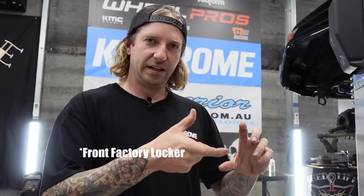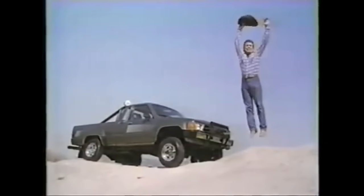Unfortunately we're sticking with the factory locker. As we all know, there is a slight design fault in the front diffs - the adjusting nut on the Toyotas can come loose, and then your diff sort of walks. I think that's what happened originally. We're going to tackle that by TIG welding some locking welds on that nut so it can never come loose, and we'll stick with the front locker until Harrop design their new ones.